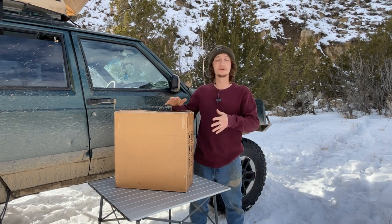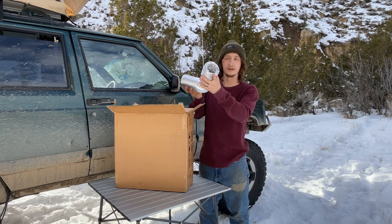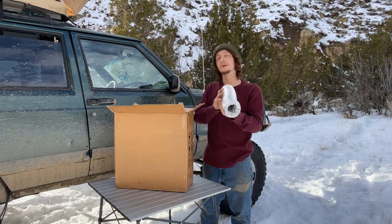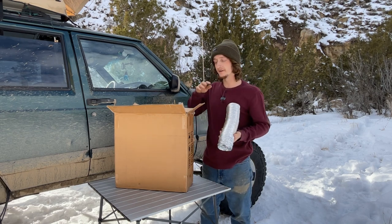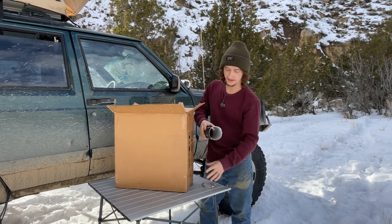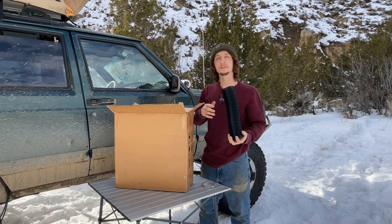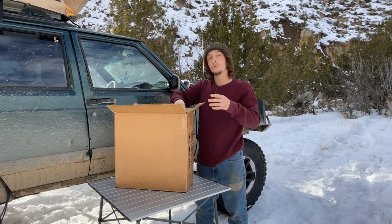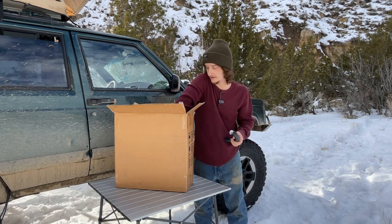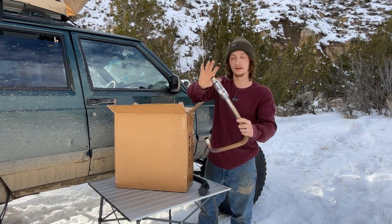This is the original box, so I'm going to show you basically what it comes with. This is something that actually doesn't come with it, but I went and bought at Lowe's — it's just a three-inch ventilation pipe. This is commonly used for kitchens and bathrooms, but it is rated for 250 degrees, so I figured it would be perfect. Now, this is the pipe that the diesel heater comes with. It's maybe two feet long at most stretched out, so obviously that's not enough to reach a tent — that's why we had to buy that other ventilation pipe. This is the intake for the combustion chamber, an air filter, the exhaust for the combustion chamber, and a little muffler.